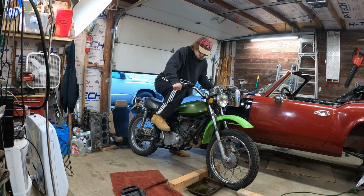I got a new tube put into this tire, so I'm gonna throw it back on and see if I can bump start this thing and get it running. I've had it running for about 30 seconds, but that's pretty much all. I think I'll put a clip in this video. It wasn't very long, but I think a bump start will get it running, and then I can clear out all of the carbon that's keeping it from starting and running long term.